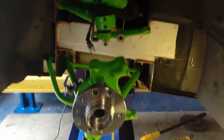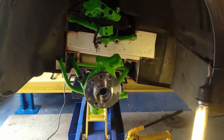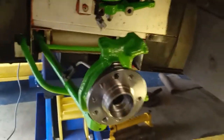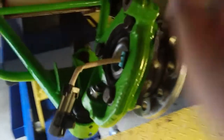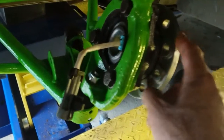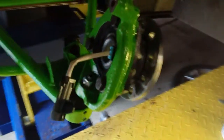This is the front suspension being put back together. There's the upper wishbone and lower wishbone. After the video about putting the ball joint in, once the ball joint was done, the upright was connected and that nut was tightened. That's done before putting the hub on because you need access — part of the hub creates difficulty getting a socket on top.